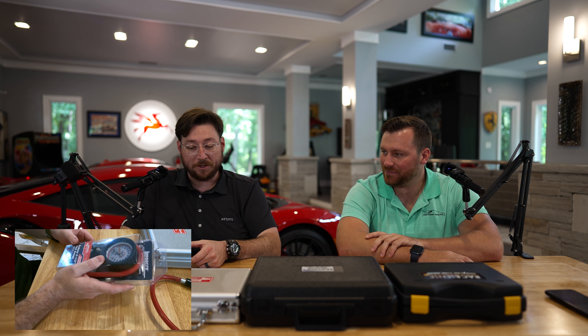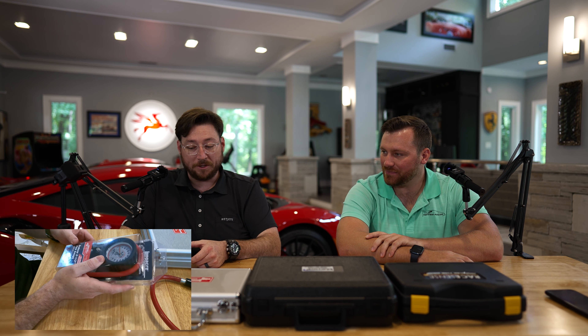Those basic stick gauges are generally relatively close — within three or four psi — close enough for everyday use. But when we're talking about track days and racing, especially when you're setting up tires instead of just a car, accuracy is king. We'll talk about some endurance racing applications where it really comes into play. So, first up in basic tire gauges, these are all Long Acre products — your standard go-to gauge, basic zero to 60 psi.